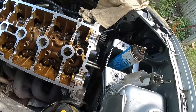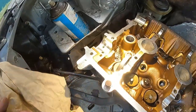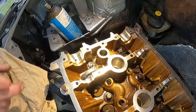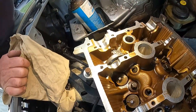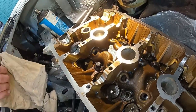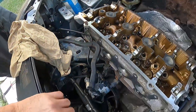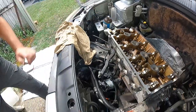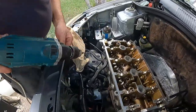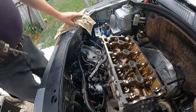You can see the smoke coming off, so there's definitely heat being built up. The critical thing is I've centralised the first drill and then I just keep building it up — I've got that very fine edge around the outside, which means I've centralised it. This whole head, if it gets reused, is going to be completely stripped down, bathed, washed, blown out, and reassembled. So I'm not too worried about the swarf. The sump's coming off — I'm going to do the conrod bearings and ARP conrod bolts, which is a popular conversion on the F4R.